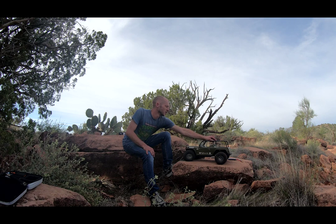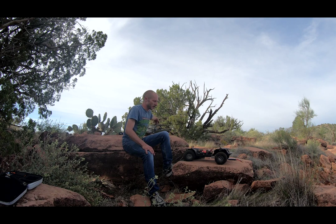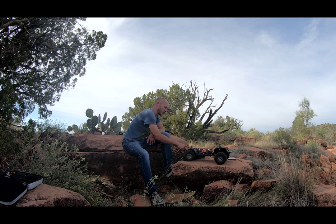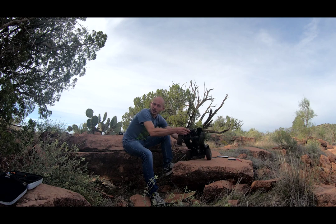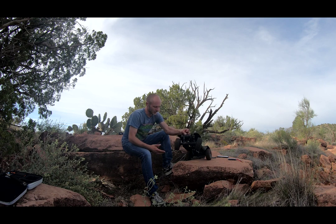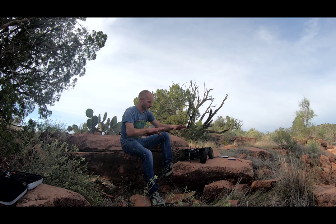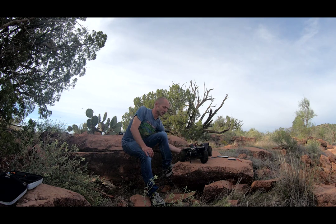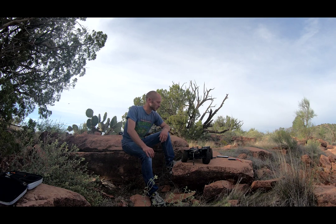My shock mount position, the shock mount holes, I've kind of settled on dead center in the rear to keep the skid up a little bit, and then all the way up in the front, in the top center. The front springs, I did droop with a pen spring. It's where you pull the shock apart and you put a clicky pen spring in, working the opposite way of the shock. And that helps the shock stay lower. It's just something you can do to keep the truck squatted low. That was the main objective, to get everything as low as possible and as far forward as possible.